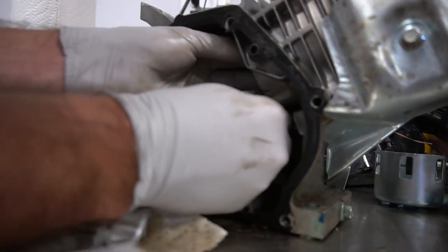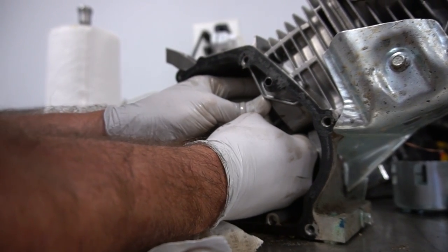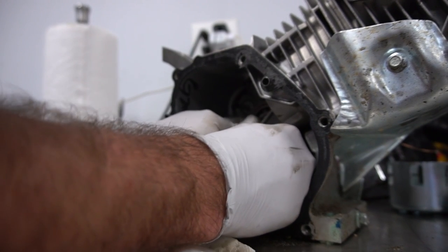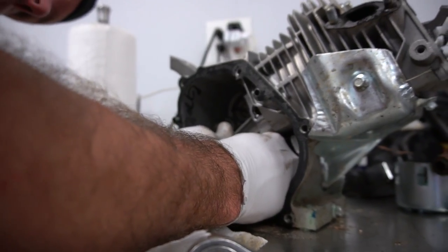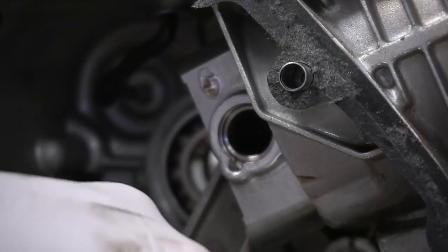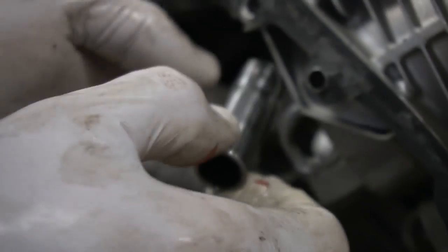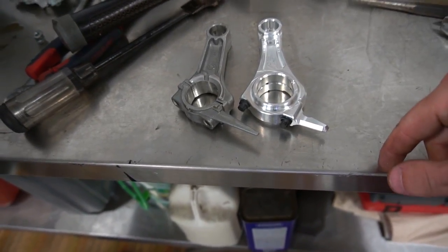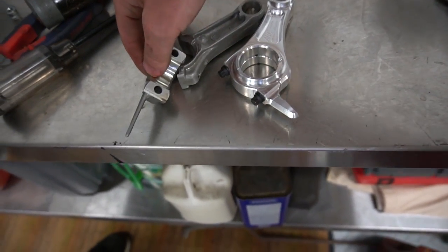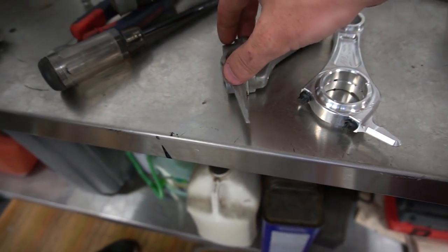Now I'm going to see if I can cheat again. We're going to try to remove the wrist pin without removing the head — the kind that'll go across the shop if you're not careful. The new billet rod has a smaller dipper but it actually has a scoop in it with pressurized oil, which is sweet.